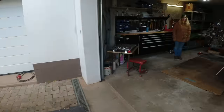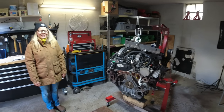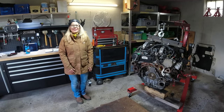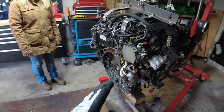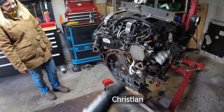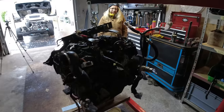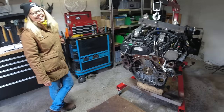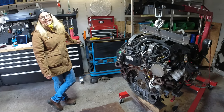In this episode we're going to disassemble our 3-liter SDV6 engine out of our 2016 Discovery 4, which suffered an engine failure. We bought it like that and already confirmed it's the original engine - we can see that on the date stamp code from the crankshaft, it's an OEM crankshaft. We think this engine failed mainly because of bad service; we don't think it has a snapped crankshaft but we'll find out. This will be sort of an 'I Do Cars' style engine disassembly video, except we're going to reuse the water pump.